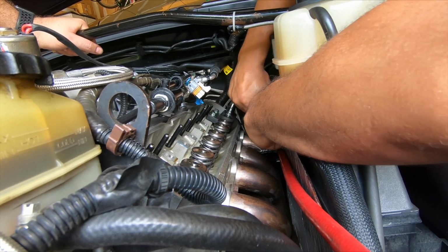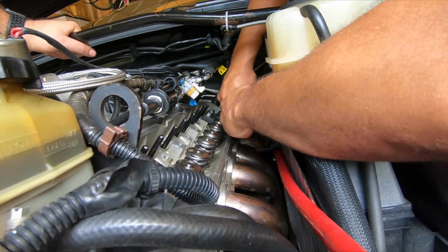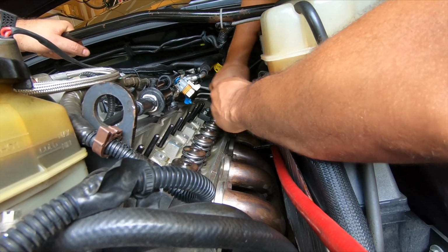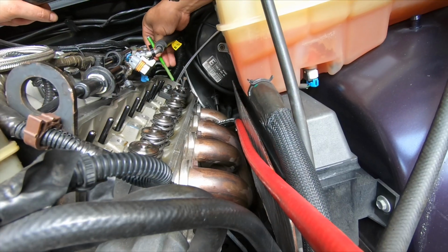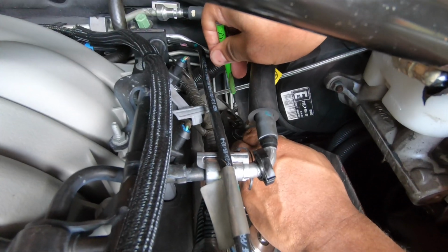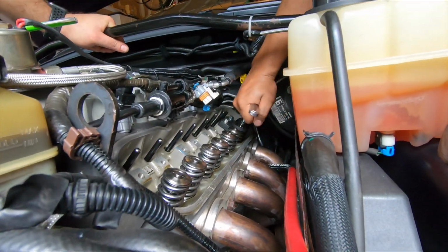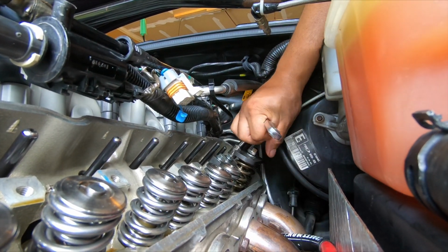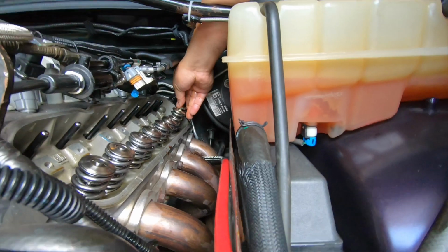So you should be plugging the oil galleys to make sure that these retainer plugs don't fall down into there. But we've done this. This is the last set, and we're pretty confident that we won't have that problem. And now that I said that, we will. Guaranteed. Got both of them on that shot. So then he backs the tool off. And then you just reverse the operation to put these back in.